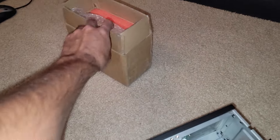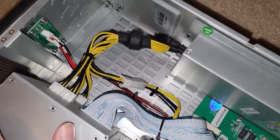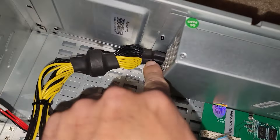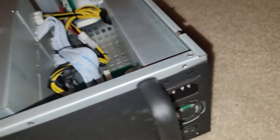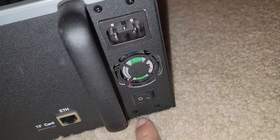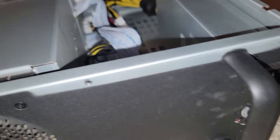So I ordered a control board and we're going to use that one right there. I suspect we'll probably need to remove the power supply. It looks like there's one screw coming in through the top section that we might need to gain access to — sure enough. So this screw right here, and then we might have some screws on the backside right here, four total, to give me some room to move that power supply a little bit.